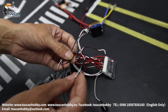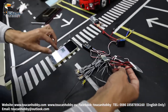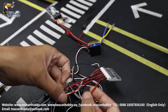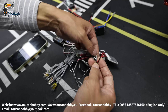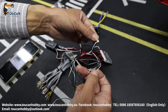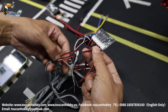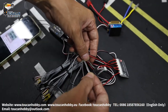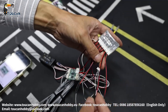I cut the wires and welded them to connect to this Bluetooth board directly. According to the manual — which we send to you — number 1 is the brake light. So running in parallel with this one, make a connection and plug in. It's positive and negative, so here you make the welding connection. Number 2 is the reverse light, so make the connection and weld it.